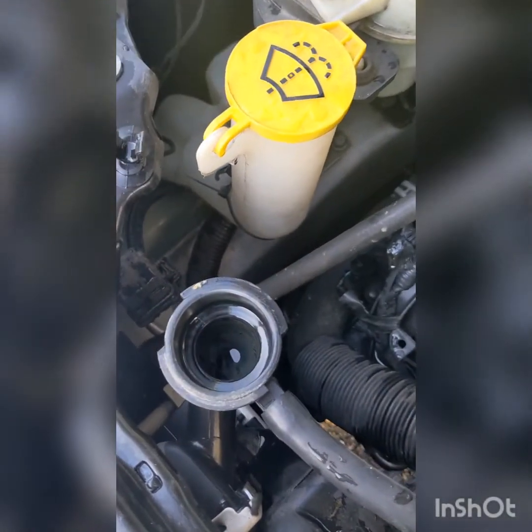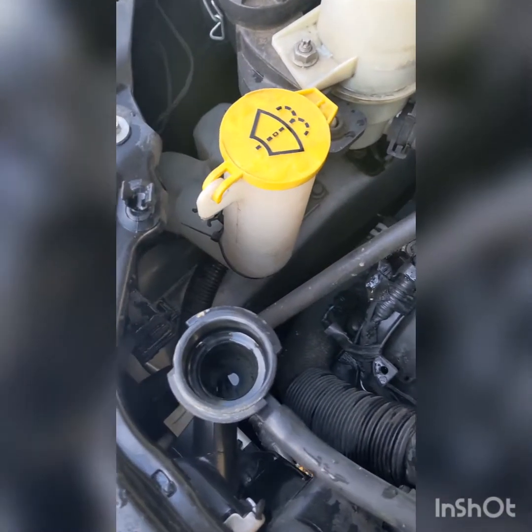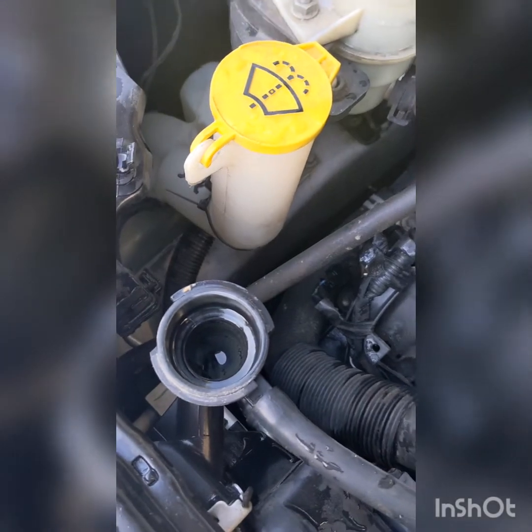First, you want to drain out the old coolant, which a lot of people don't even know, but you are supposed to drain out your coolant. And there's supposed to be nothing in the reserve tank, because if you mix coolants, it can cause a jelly-like substance to form and your engine can blow.